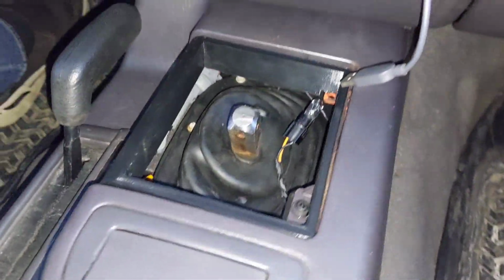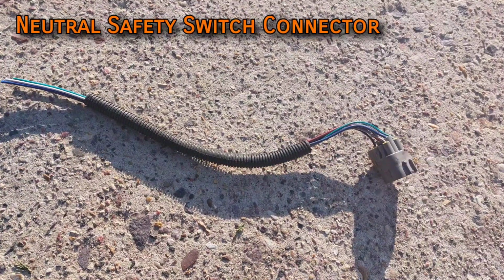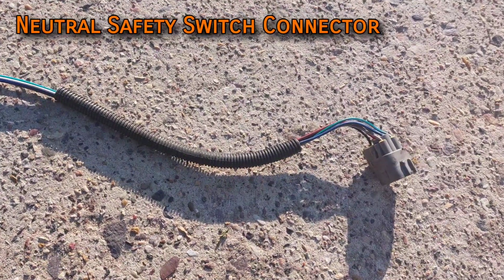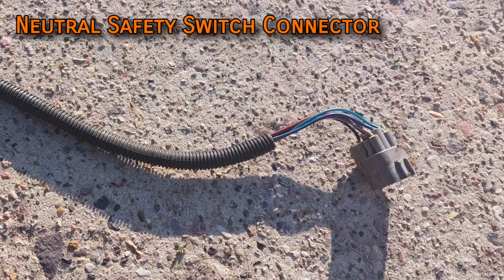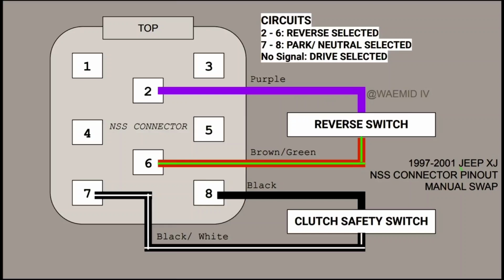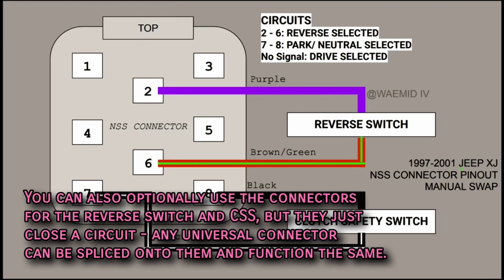Some miscellaneous parts you'll want are the sensor side of the NSS connector. This can be either cut off your NSS after you remove it or sourced from a failed NSS on another Jeep. We're going to do some minor wiring mods, so we have a clutch safety switch and reverse lights, which I'll cover in the next video when I'm actually doing the swap.